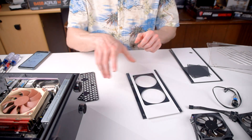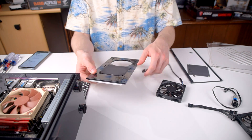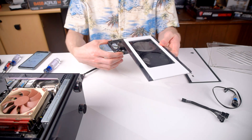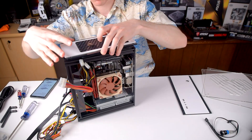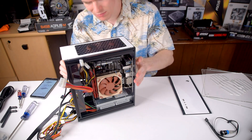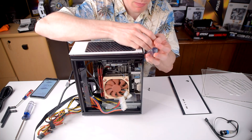If you'll be using fans, the installation is fairly easy since it's done outside the case. First, figure out which way you want the wires to come out, then line up the mesh and fan with the mounting holes in the top panel. Once you've done this for both fans, the fan grill fits in place on top of them and gets held down with 6 small screws. After the fans are in place, you mount the top panel with the screws and nuts that fit into the channels on the aluminum — another tedious process, but by this point in the build you'll have a pretty good idea of how to get them to line up.